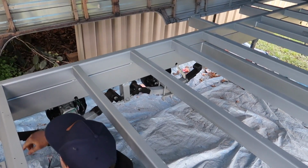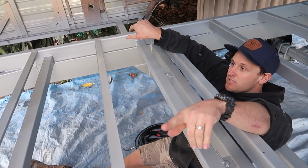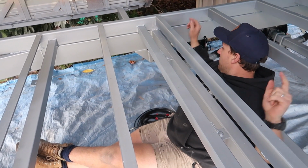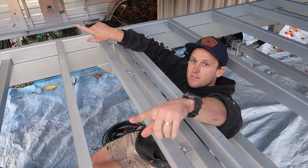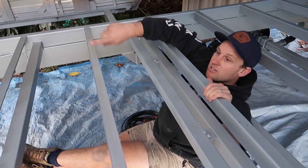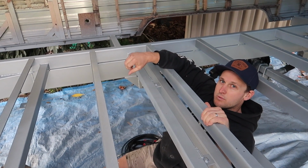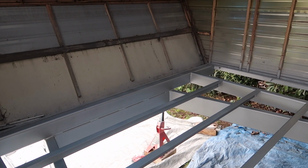But for the side lights, I was talking to the guy, and he says usually you just drill a hole for your brakes, come out for your brakes, and then just run from these holes, probably from this front hole here, I'll probably run to the side lights. Along the chassis. But then it's got to go all the way over to that side too. So I might drill another hole at the front. It's pretty easy to do. Another hole at the drawbar, and then at the back, we'll go to the rear lights.